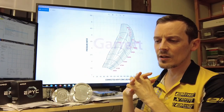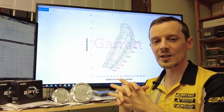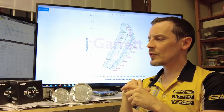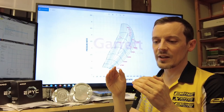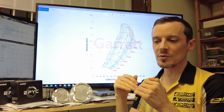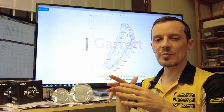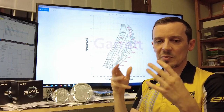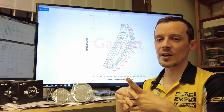I would highly recommend our 'anti-lag for dummies' video on how to set this up and how it correlates with our engine — definitely recommend checking that out. For launch control, we'd recommend running the engine at the minimum possible RPM to build max boost pressure — probably around 4,500–5,000 RPM — to leave some margin for the lower RPM range. Then do a clutch ease-in so you're not spinning your wheels at all on the launch, since you get such a performance advantage from that type of launch.